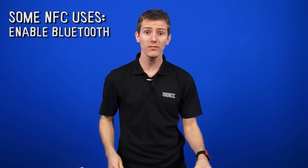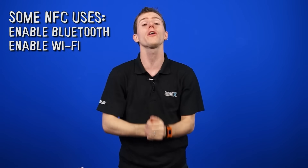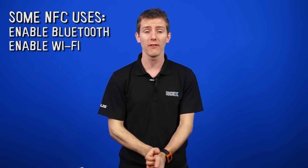Samsung Galaxy devices use an NFC technology that they brand as S-Beam, except that instead of using NFC to enable Bluetooth, they use it to enable a Wi-Fi Direct link between the two devices for ongoing communications. You can use that for file transfer and all kinds of other cool stuff. Wi-Fi Direct also has the advantage over Bluetooth of being much higher bandwidth, supporting up to 300 megabit per second. Many smartphones these days have NFC, including Google Nexus devices, Blackberries, and this HTC One also has it.